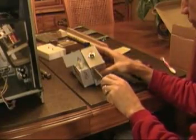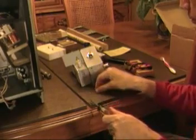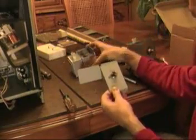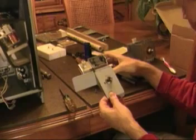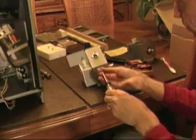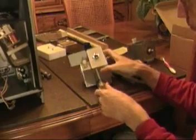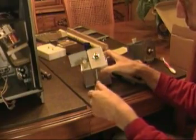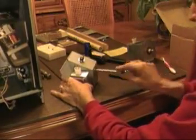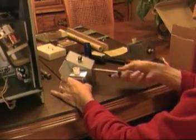I took the thermal sensor and its associated bracket off — it's held with just one screw — removed it from the bad magnetron and transferred it onto the new one. The screw holes aren't threaded, so you have to make yourself new threads with a little brute force. As soon as I switched to my right hand and put some muscle behind it, the screw went right in.